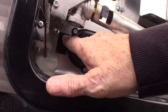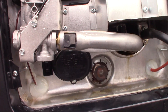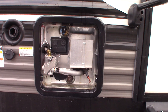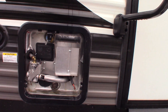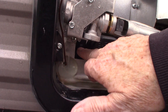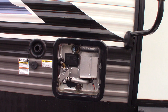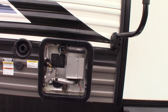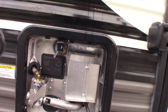This rocker switch controls the electric heating element behind that cover. Then you have your gas burner — there's a switch inside for that. At the campground you'll have the electric element turned on to keep your water hot. But when you're showering, for example, you can flip on the gas burner, which gives you more hot water. It's not on-demand, but it's much faster recovery than with just the electric heating element.